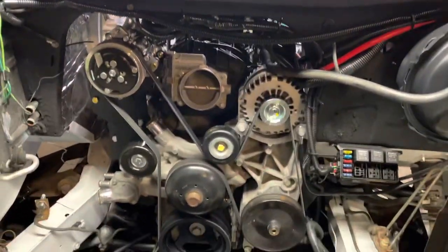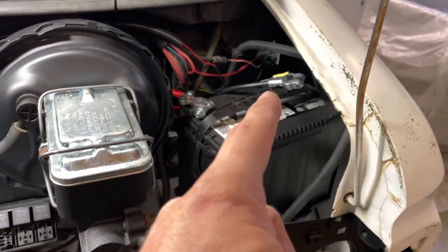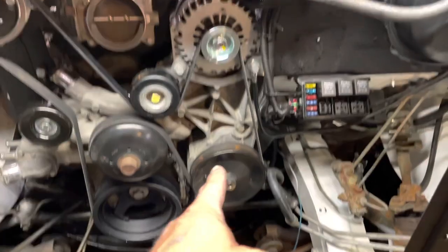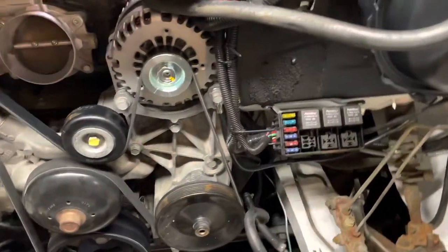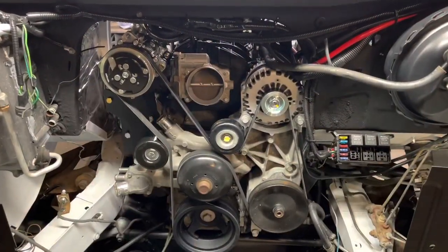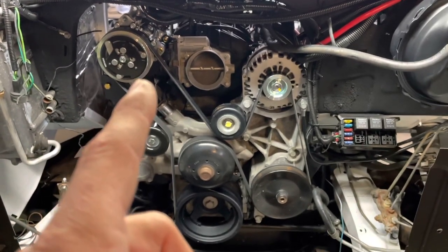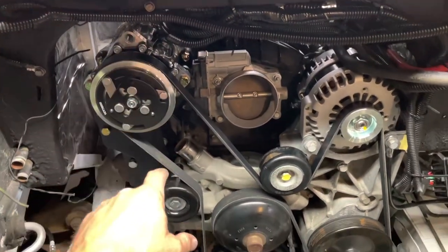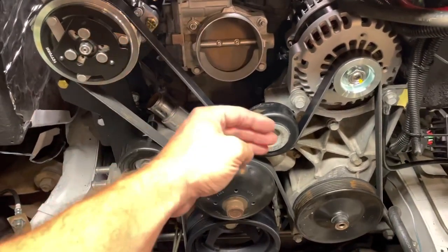Keep in mind I still got to organize and wrap and stuff all this wiring. I've got my positive cables, everything hooked up there. I got a negative cable but the one I have is a little bit too short — I want to go down there to that bolt there, down around underneath. So I just stuck one right there for now. I'm not going to run the engine with it there — it's not going to hit the fan or the belt or anything. On the subject of the belt: the belt that's on there is about the third one I've got, and it's just barely long enough to pop it on there. But it's pulling the compressor down a little bit. That stuff's kind of loose, so it's not tight enough.